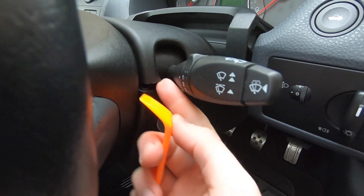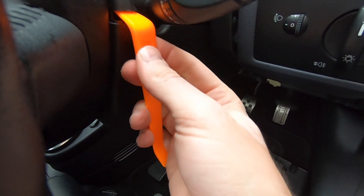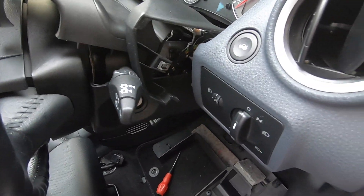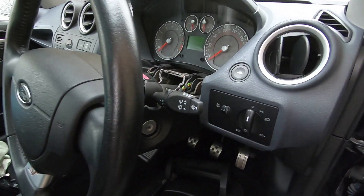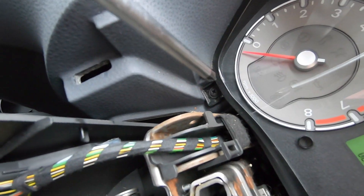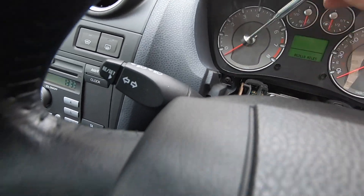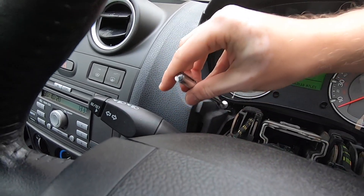What I had to do was — you can't get this out without the top piece — so I used one of these little plastic pry tools and got it underneath this corner, same on the other side. Once that whole piece comes away, you've got a Phillips here and a Phillips in that corner. I've got this little magnetic tool — put it on there, unscrew the final bit, and then you can get hold of the screw.